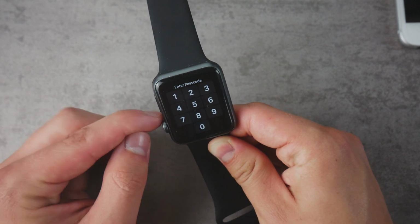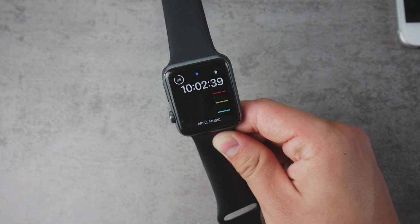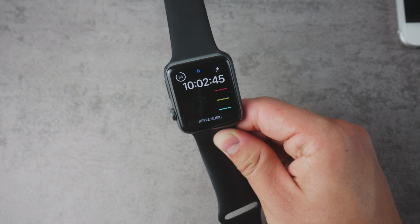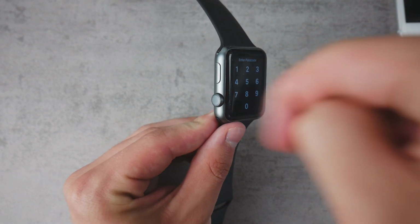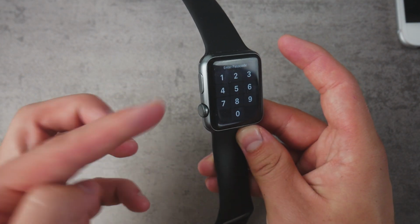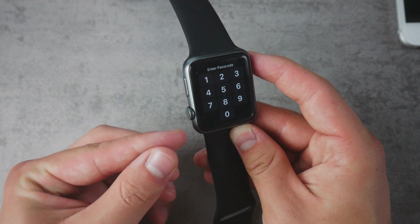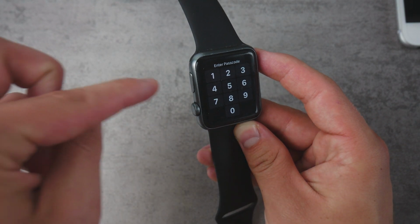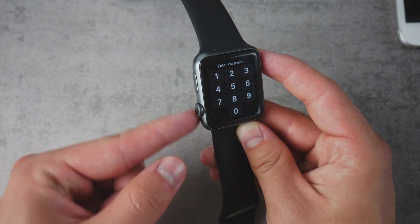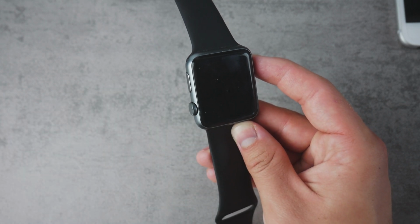But anyways, now you should bring the Apple Watch to the bathroom or to the kitchen and place it into a sink under your faucet and simply wash it using that for about 10 to 15 seconds. You should pour water exactly on the digital crown and move it, click it, do whatever you want to get any kind of dirt out of that space and make the digital crown usable again. Like I said, if there are some sort of substances or some kind of dirt inside it, the water alongside the movements, the clicks, the rotation and everything should make it go away and clean it completely.